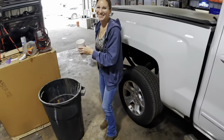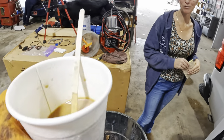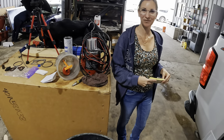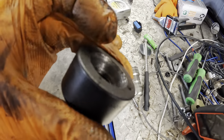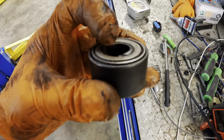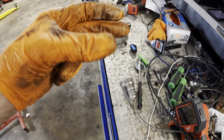I need to go fetch the stud pulling tool. This is a wheel stud puller device — it's a conical shape designed to fit the acorn shape of the lug nut. On the back side there's a bearing plate, which allows the stud to turn freely with minimal friction against the bearing plate in order to draw that stud into the wheel hub.